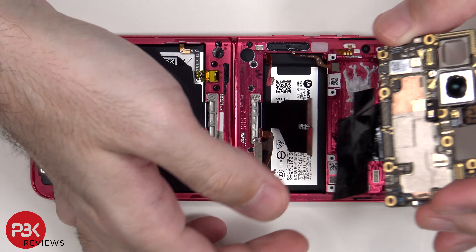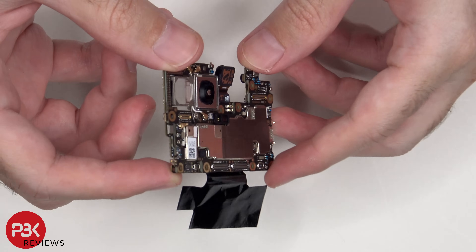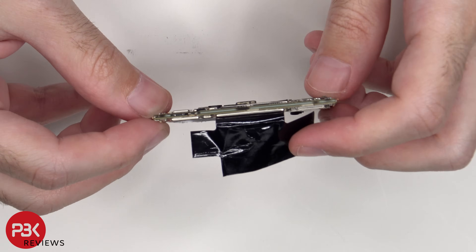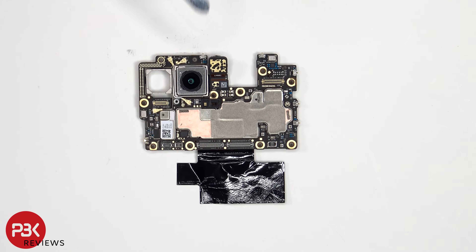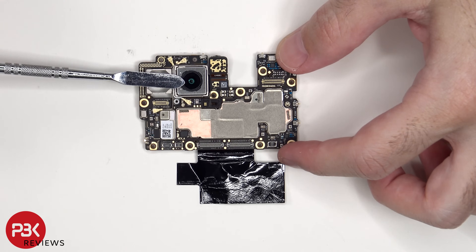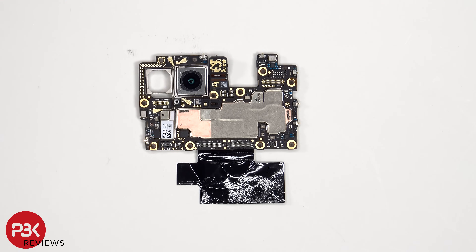Let's take a look at the back of the camera. The motherboard is a dual layer design board. On this side we can see the 50 megapixel primary camera, and this camera is the only one with OIS or Optical Image Stabilization. There's a secondary microphone on the top corner, the autofocus and light sensor on the back, and some copper tape on the shields.